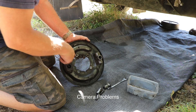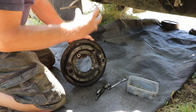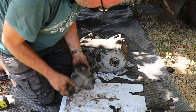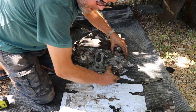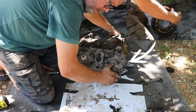Right, so now that's done. I'm going to try and explain this quickly. Those four bolts that we saw in the beginning fit onto the rear of the transfer case — the output shaft for the rear. I'll show you in a second. That's the rear output shaft here. I'm checking the play, and those bolts there is where the plate bolts onto.